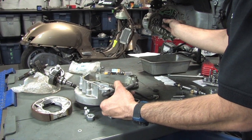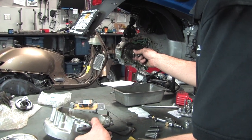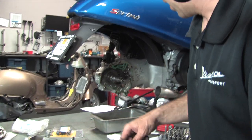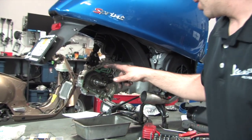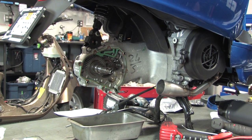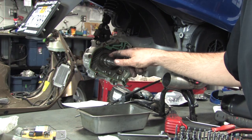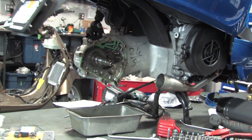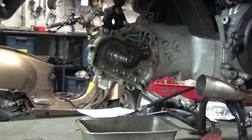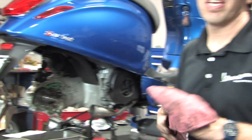Put the new one right in the bearing — nice and simple. This one lines up with the bearing. With the excess oil drained, typically you'd replace the gasket, but this scooter is so new the gasket looks very well intact, so I'm going to go ahead and leave that alone. Grease this little lip, pop the gear cover back together, and re-torque all these fasteners in a criss-cross pattern to about 16 foot-pounds — and instant overdrive kit.